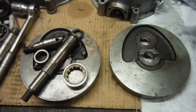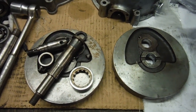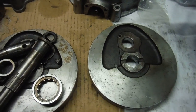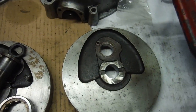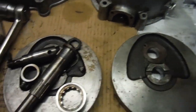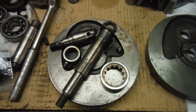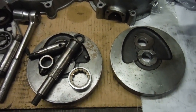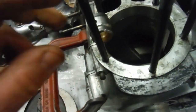I've got the engine stripped down, split the crank, got the new conrod and crank pin ready to go in, and at that point I found that the crank pin just dropped right into the locating eye on the timing side flywheel — so it was too loose, although it would have been a decent enough fit in the drive side flywheel. So I needed another timing side flywheel, which I couldn't get on its own, so I managed to locate a decent second-hand crank.